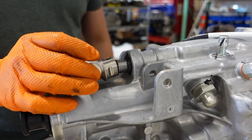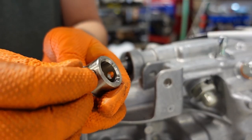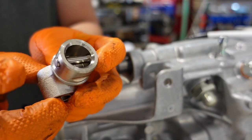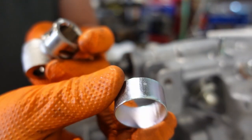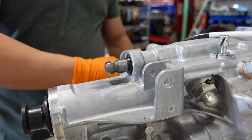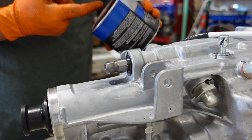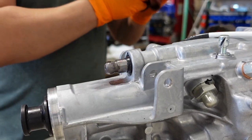The two slots in the base of the flex joint are for the crush collar to be beaten into the recesses on the side of the flex coupler, keeping that collar in place so the roll pin can't back out during operation. The roll pin just slips in place and is left loose to allow the flex coupler to move left and right. The collar then covers the roll pin to keep it from slipping out, and the crush collar is staked in place.